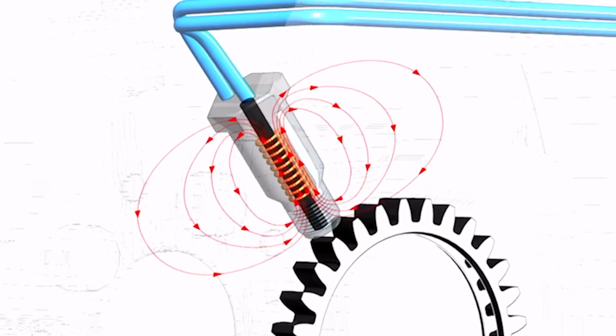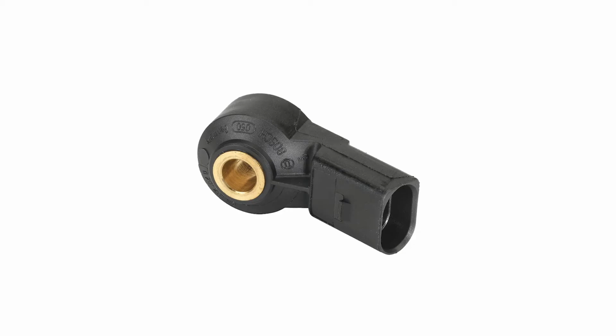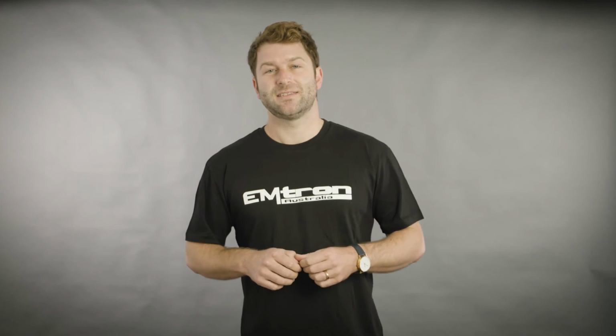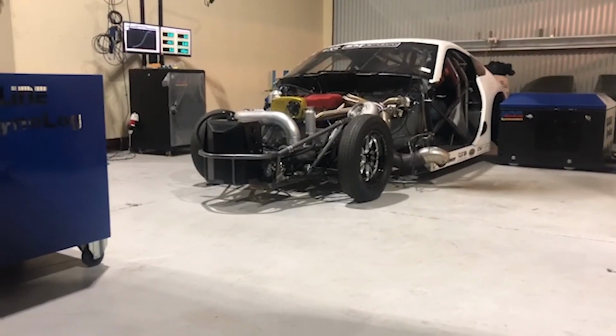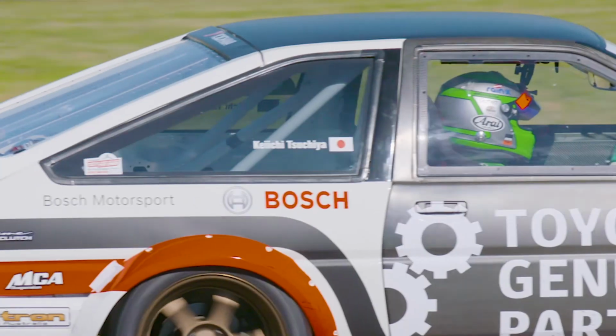Wheel speed sensors are able to be wired directly to the ECU for features such as traction control. This ECU supports dual knock control using inputs from a piezoelectric sensor. Each knock input is differential for improved noise rejection and allows for individual cylinder knock detection. The ECU can automatically provide individual cylinder ignition trimming based on the knock status.